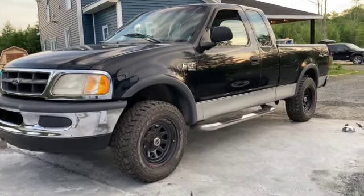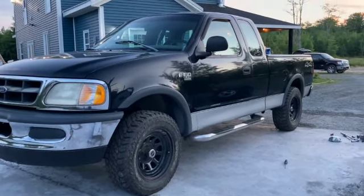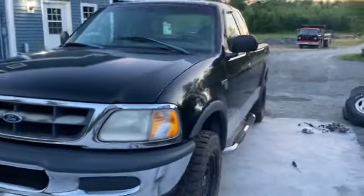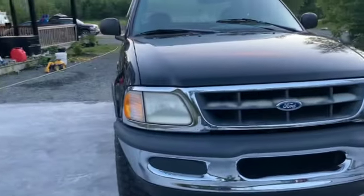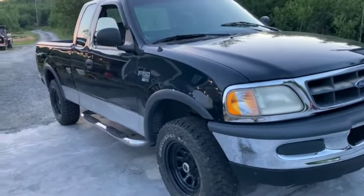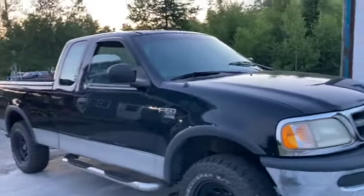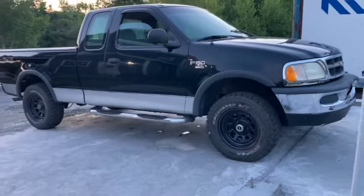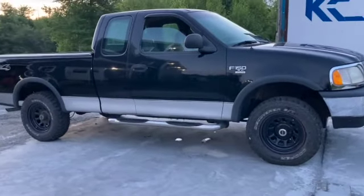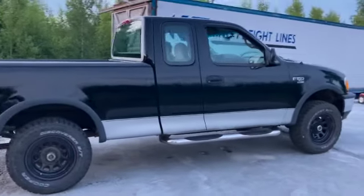I'm about to call it quits for the night but I think I made pretty good progress — starting to look quite a bit better. Turns out the miss in the engine was actually just a fuel filter. The fuel filter was definitely more than clogged, so now it runs great. For under $10 I put a new fuel filter on it and it took 10 minutes. I put a new air filter in it just while I was at it — just what the hay. So now it's an excellent running truck and it's starting to come around, starting to look pretty good. Stay tuned and follow along — hope you like the progress so far. Thanks for watching, I'll see you soon.